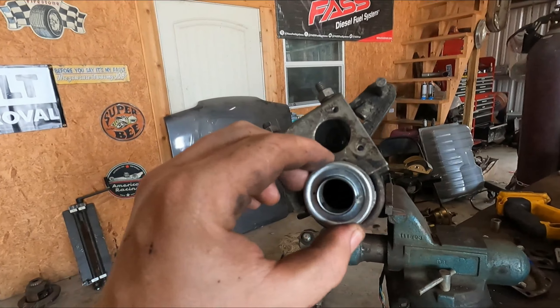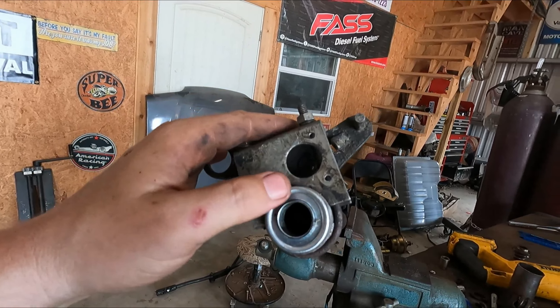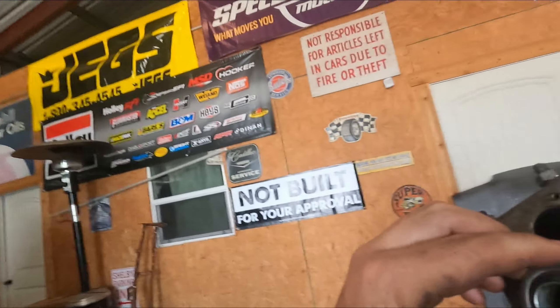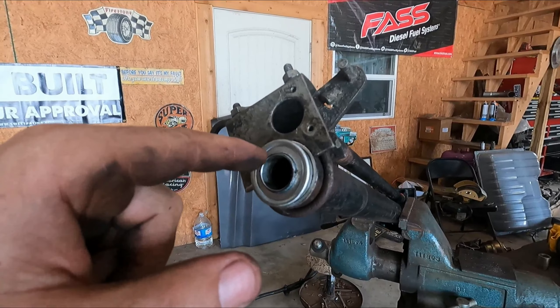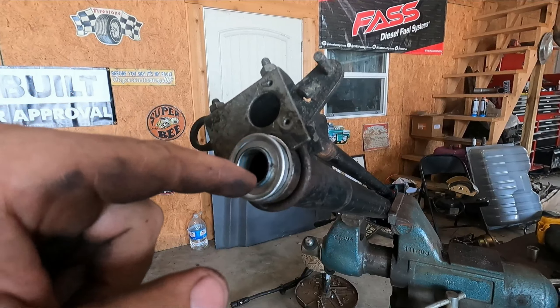When you come over here to this tube, take your bearing and put it right there in the end, tap it in — very simple. Once it's tapped in, you can put a tack there, tack there, whatever. Then I'm going to put a tack on the shaft to the inside of that, just so it doesn't move. You can get away with doing a collar with a lock ring too — I don't care, do that. So I'm going to drive this in and slide it over the steering shaft.